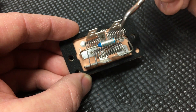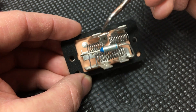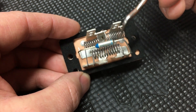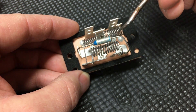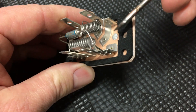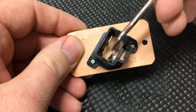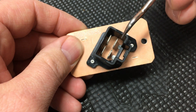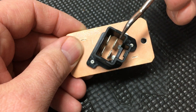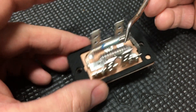And if you want low, we're going to have to go through all three of these resistors so we can drop that voltage down low enough for the blower to run nice and slow. It'll jumper over to this one right here and then output over — so you can see each one of these has their own output: one, two, three — and then we have the main ground coming in.